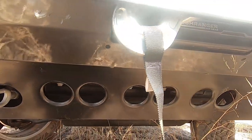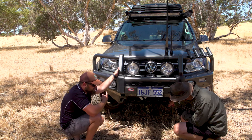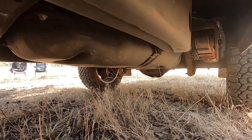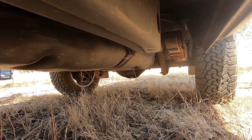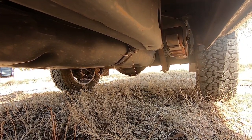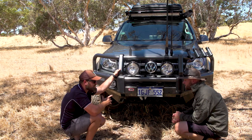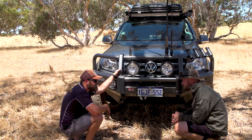This bash plate comes with the bar and does go a little bit under. I do have issues with clearance — just the standard Volkswagen plastic 80-litre tank, and it is the lowest thing on this car. I'm very conscious of that when I go off-road. It does sit to one side, which is probably one of the big downfalls for me — I have to make a mental note of that when lining up for something, especially over rocks.